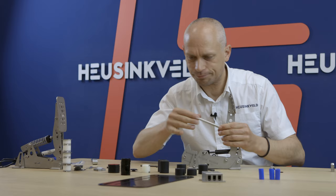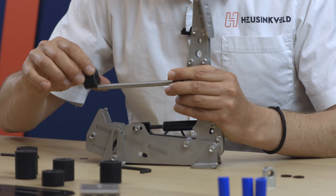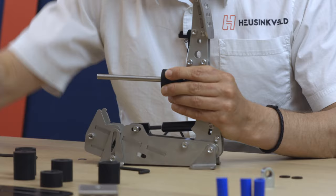Now let's build up the stack — it is quite similar to the Sprint stack. I like to use a 19 up top. Always use a washer between the rubbers. A 28 soft in between, another washer, a 37 soft on the bottom, another washer. Now let's reuse this spring and the new spacer to keep the spring from bottoming out and damaging itself. The spring centering washer goes in as well as the new back plate — it clicks right into place as you're used to seeing.